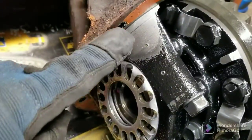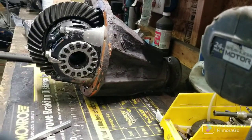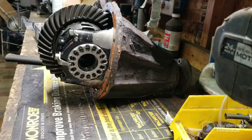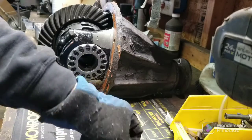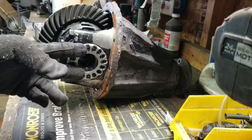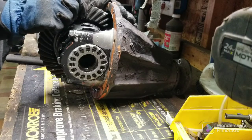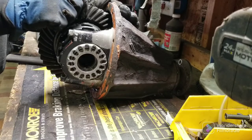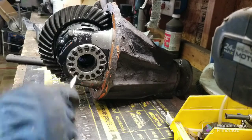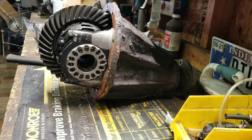It's important that you mark your caps. These are already marked because the fellow just put it in. Sadly, he overlooked one simple thing — not a big deal, not his fault. We all make mistakes out in the shop. But you can take these off with a 12 on both sides. These are the retainers that hold these two adjustment rings in. Another important thing: you should have a dial indicator for doing this job, so you can set your lash. I got the gift of the eye — I can set that back without using a dial indicator, but I recommend you use one.